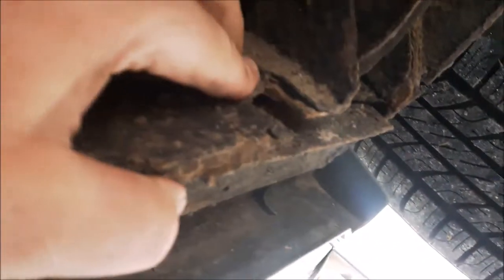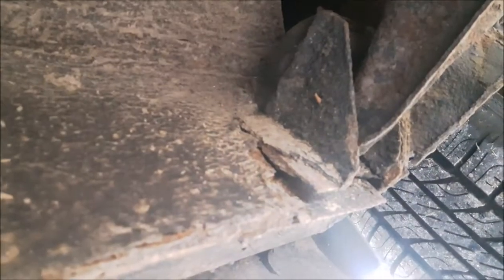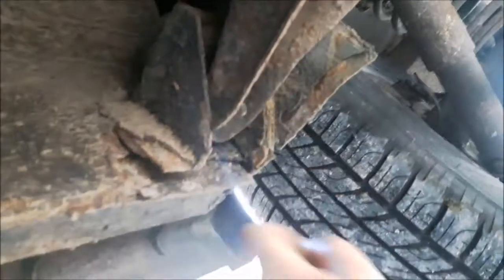So this is the driver's side. At the back here is a patch that a local garage did for me a few years ago, and to be honest, I'm going to tidy this lot up because it's solid, but it ain't pretty. So what I might do is unbolt the mount, see if I can pull the mount tight into the sill and re-weld it. As you can see, a lot of this original bitumen underseal is starting to flake off. It needs quite a lot of attention under here, but then it is getting on, the old Duchess.